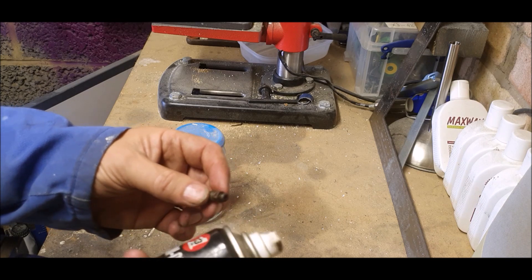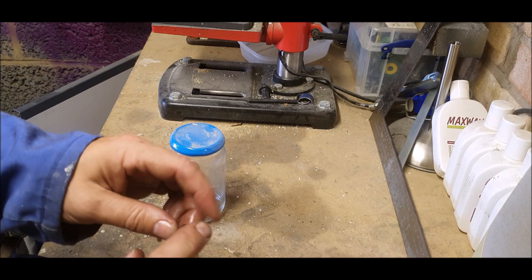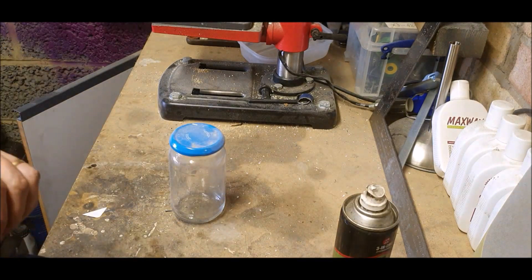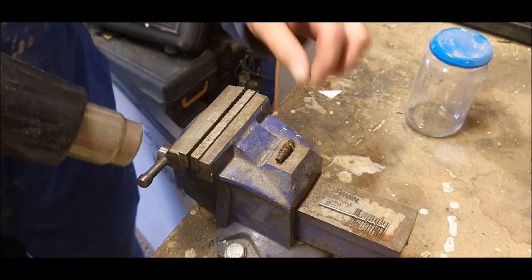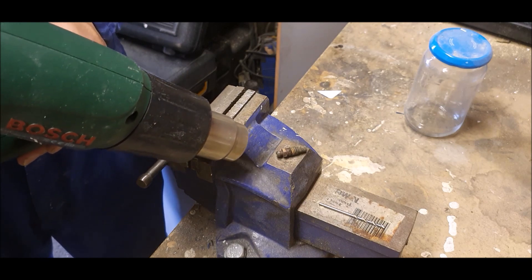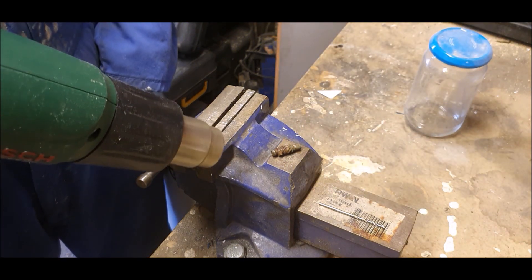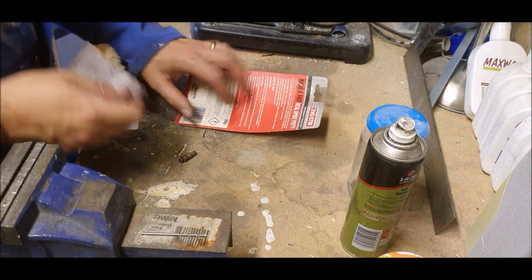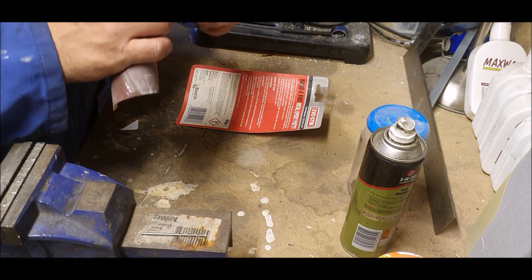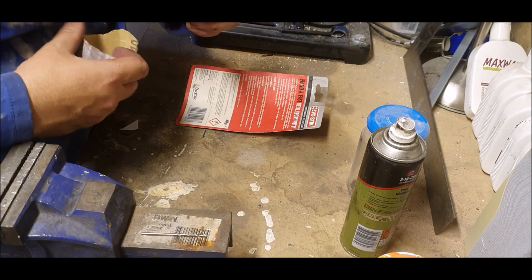The first thing I'm going to do is wash it with some tool cleaner, just to get any oily residue off that might not sit well with the chemical metal. Now I'm going to make sure it's absolutely dry with the hot air gun. That hot air gun does make it quite hot. Now obviously this is an out-and-out bodge and not really a recommended thing — this is just to get us back on the road and keep us on the road until I get my act together and get some more bleed screws.